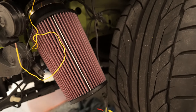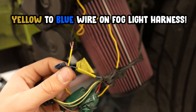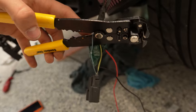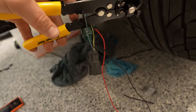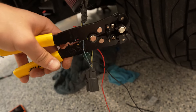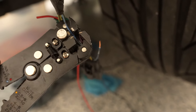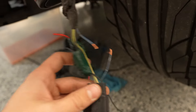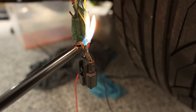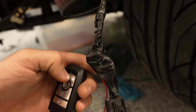Take the yellow wire — and mind you, I have a 2020 Mustang, so if you have a 2018+ Mustang this is going to work. Go to your fog light harness and take the blue wire, then heat shrink it to the yellow wire. I'm going to snip this blue wire in half so we can do the heat shrink. If you guys plan on doing any wiring work, I highly recommend these wire cutters — they strip the wire back perfectly. Heat shrink butt connectors are honestly the way to go: easy to use, get the job done, and waterproof.